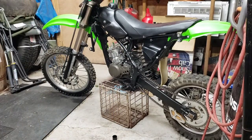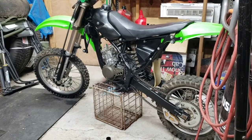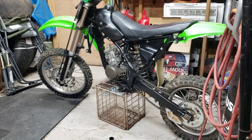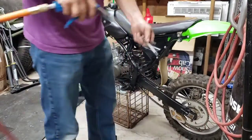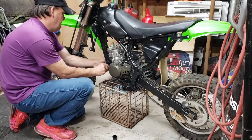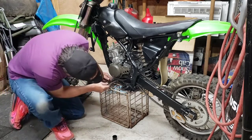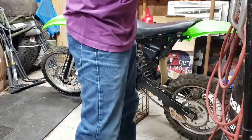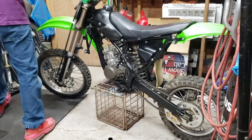You do not want that coming in. All right, see if we can get a motor mount here. Same thing, like a nylon locking washer too, but clean off the bolt with a little brake clean here. I don't trust them. Make sure there's no grease on. There's a bolt. There's one down here somewhere. Another bolt. Make sure you blow off these nuts. Got a little 262 here.